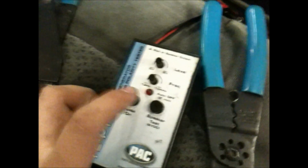So guys, there are no intermediate connections, and let me just show you with this tool real quick how it works. Okay, you hear the speaker right there? We got a tap right there, the positive and negative, dark blue positive, light blue negative, and we're verifying that is our speaker. Right there, we're adjusting the frequency, and it's only this one that's pinging, the woofer.